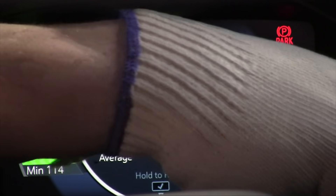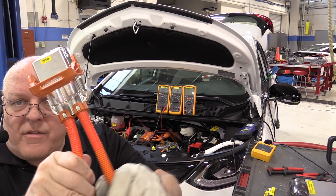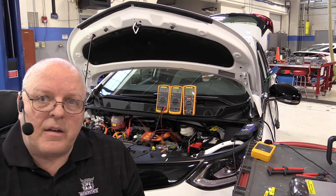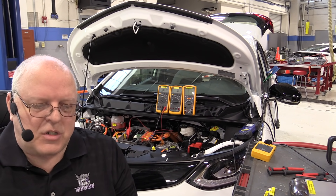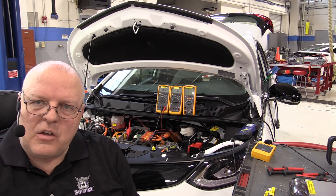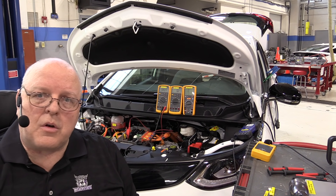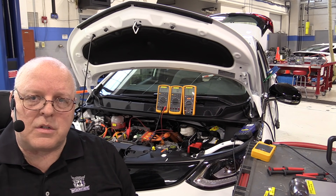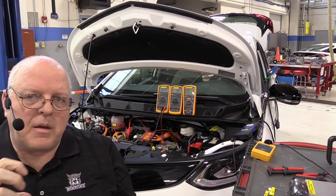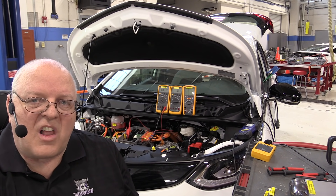What I just simulated with that yellow jumper wire was a complete short circuit from one of the two high voltage cables — battery positive or battery negative — that run in this car. On any electric vehicle, I've just simulated one of these wires being pinched or rubbed through, touching the vehicle chassis. The car can continue working with one of those doing that. Now it can't continue working with both connected to vehicle chassis — that would blow the fuse in the service disconnect lever under the back seat and the car would shut down.